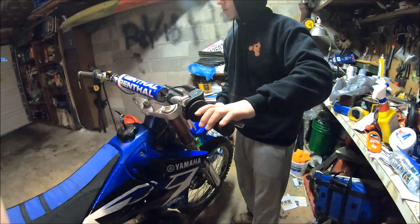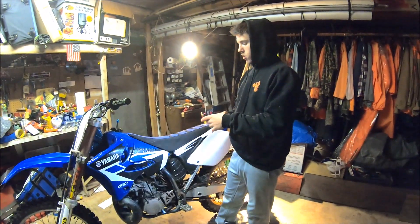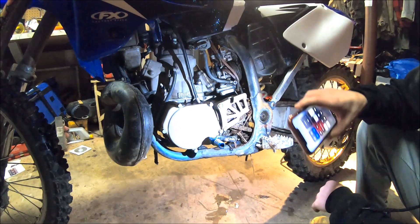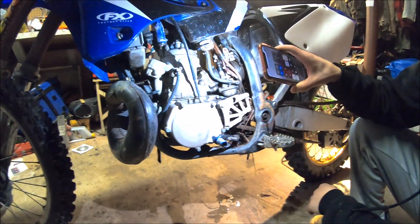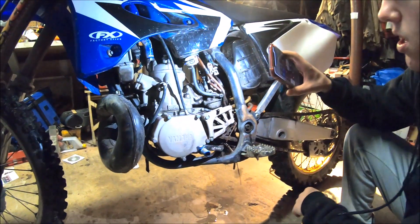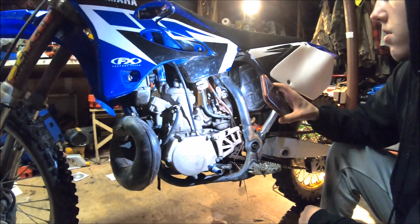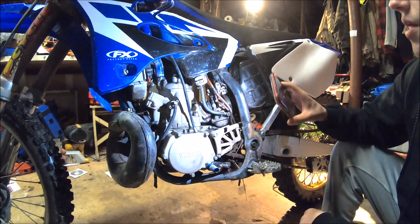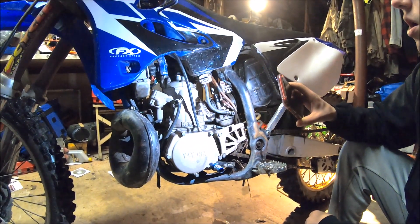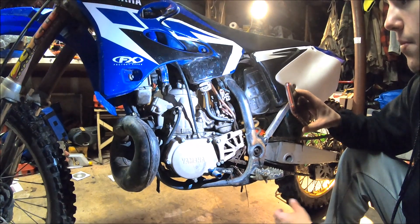Same thing up front — check the compression in the front brake. I'm gonna grab a light so you can see. Looking over the engine in general: this is a 2003, definitely an older bike. Look for any leaks or anything unusual. For two-strokes, it's common to have oil leaks coming from different parts of the exhaust. If there's a whole ton of black residue, you're probably leaking from the engine, and that's definitely not something you want to deal with.